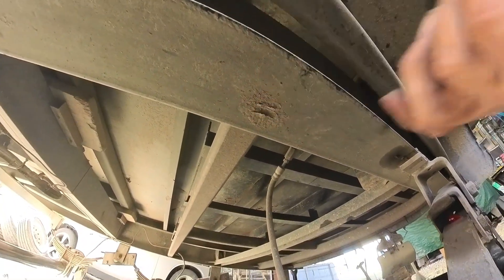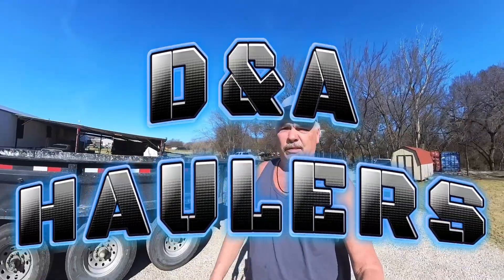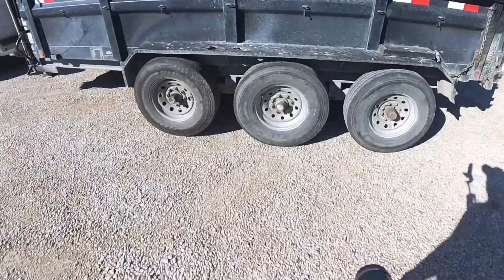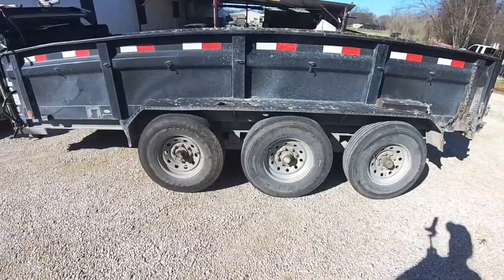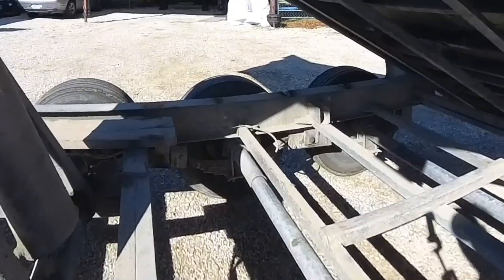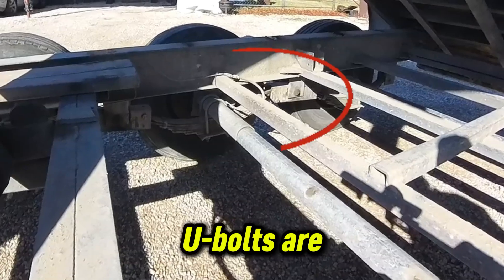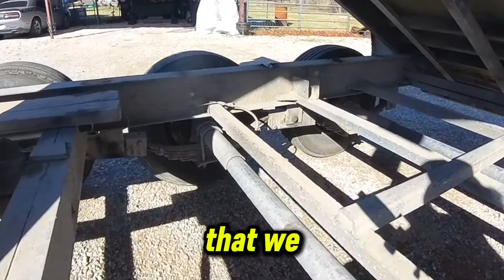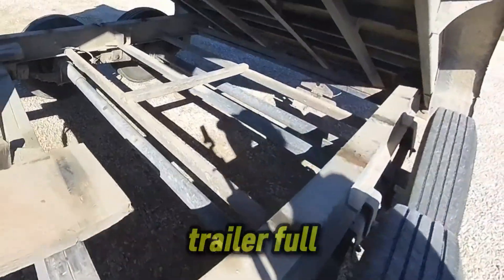Right up in here it's actually dented in for the u-bolt hitting the frame. Today we're going to be working on a dump trailer — we're going to flip the axles. The reason why is that even unloaded, the tire is sitting right up to the fender. And you can see how close the u-bolts are to the frame. On the crappy roads we have, they do hit every now and then, and I do run this trailer full.